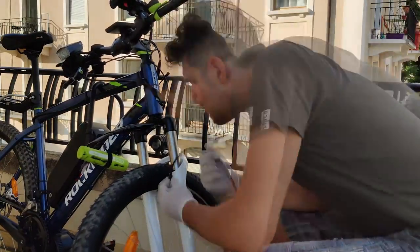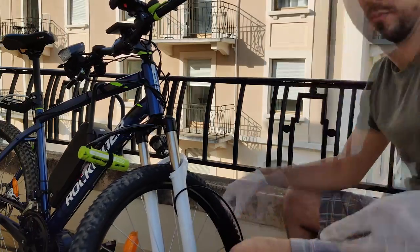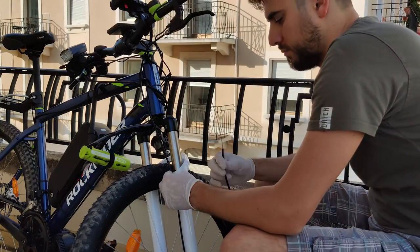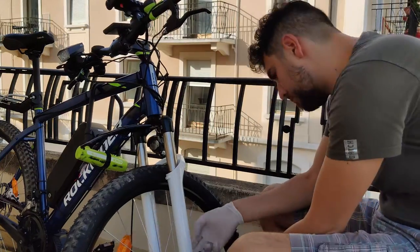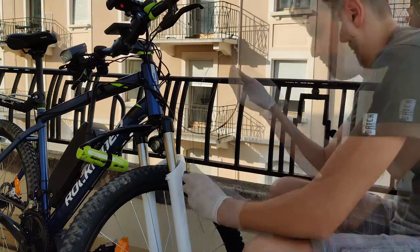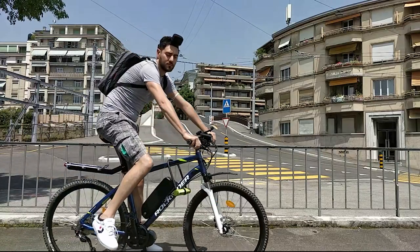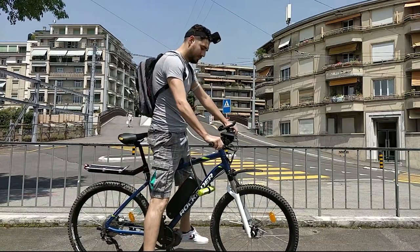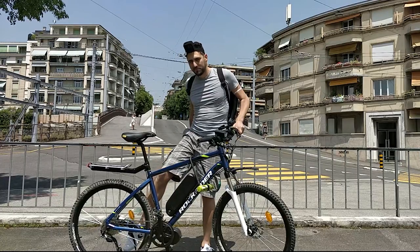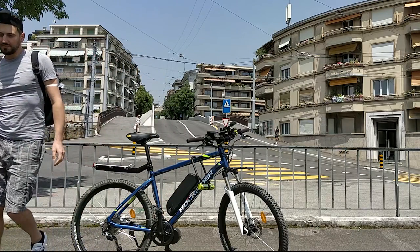In the last video I talked about the possibility to replace the hydraulic brakes with simpler mechanical brakes. I decided to give it a try, but only on the front one. It took me a little more than 30 minutes to replace the front brake, and at the end I was able to use the mechanical brake sensor that came with the kit. Don't believe those saying that mechanical brakes are inferior — they're just different, with pros and cons. I decided that for my specific configuration, a mechanical front lever would provide more control when braking. While the rear one is more inclined to completely freeze my wheel — which might be dangerous on the front — the mechanical brake offers the possibility to calibrate your braking, and this makes me feel safer. It's also easier to maintain in the long run. Two different braking systems on the same bike. Having one brake sensor is not a big deal, as long as you brake using both levers.